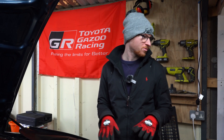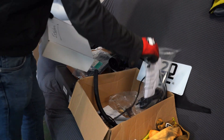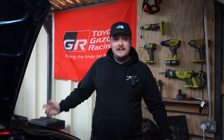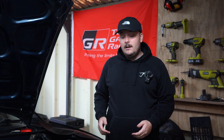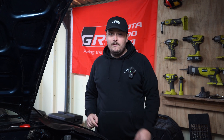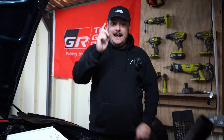Another job well done. Coming towards the end of the build — a couple of things left off the top of my head: injectors and the boost controller, so that will be up next. After that it's pretty much just waiting for the ECU delivery, then install the ECU and wideband sensor, load the base map, fill it with coolant, and change the oil. If you made it this far, thanks for watching. Remember to drop a like and subscribe to see all future episodes. Probably two more episodes coming — plus my Mark 1 is coming in for a few mods as well. So if you love MX-5s as much as we do, please subscribe. Thank you for watching. Stay hydrated, and it's cold out there, so wear a coat.